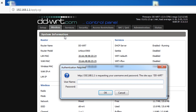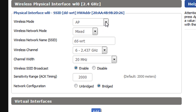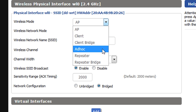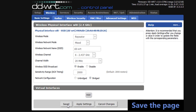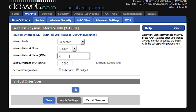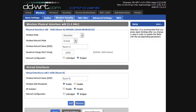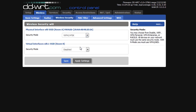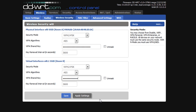The first thing I'll do when logged in is go to the Wireless > Basic Settings tab. The configuration here is very similar to what we did in the repeater bridge video, with the exception of the wireless mode option — this time I'll select 'Repeater', not 'Repeater Bridge'. Wireless network mode and wireless network name should match my current wireless network, so the repeater can connect to the primary router. I can also add a virtual interface here, which will be used as the repeater's own wireless network. Next, I'll go to the Wireless Security tab and enter the security settings for the primary router's wireless network, then in the virtual interface section enter the security settings for the repeater's own wireless network.